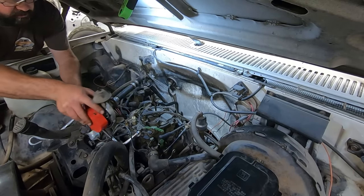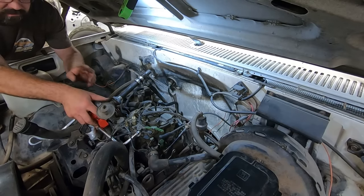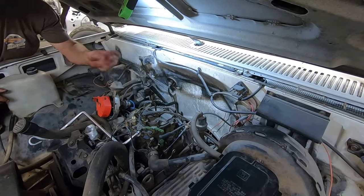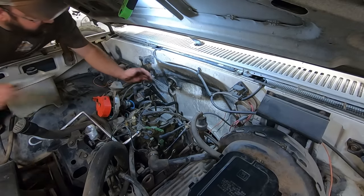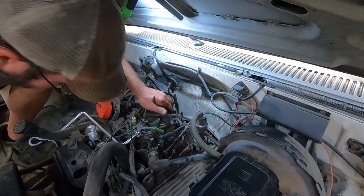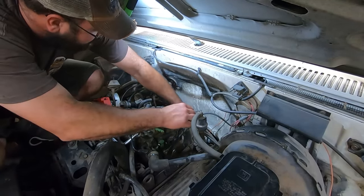And I think you got a rear main seal leak. And you go through all that work pulling the transmission from the engine to fix that seal, it still leaks. Don't be a wank. Check your distributor gasket. Let's see how much of this we can not drop down into the crankcase. We're gonna get all up inside it. Real nice and deep like. That's it, boy. Get in there nice and deep like.